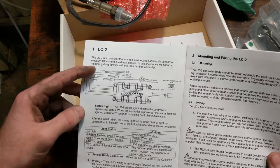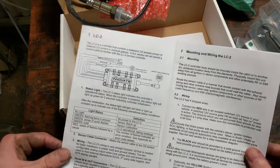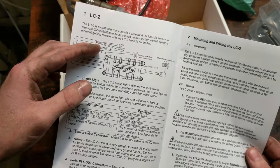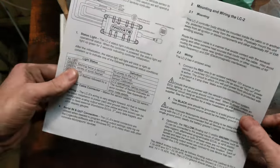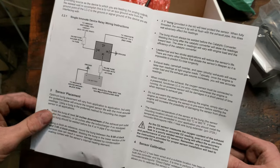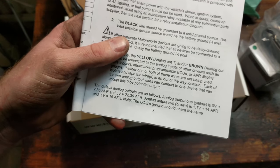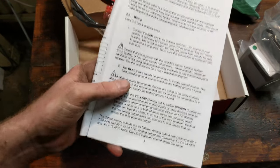Fairly basic wiring: we need power and we have two outputs. There's serial in and out, and a cable to the sensor. You've got black and red for 12-volt power, which we'll use as ignition-switched so it's not on all the time. The yellow output is a proper wideband output — zero volts equals 7.35 AFR and five volts equals 22.4. The brown wire is the emulated narrowband. We'll wire the brown one into the stock ECU, which is expecting a narrowband, and wire the yellow one to the gauge so we can see our true AFRs.